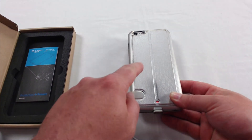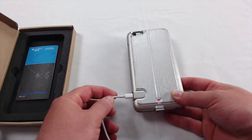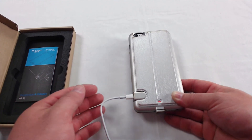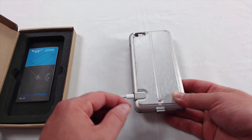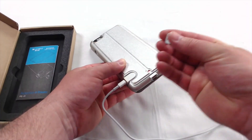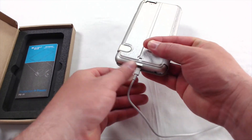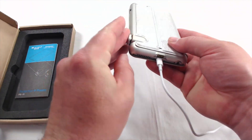The lightning cable charges the battery and charges the iPhone. The only drawback is that data cannot pass through here — only power. So if you want to sync with iTunes and you're not using iCloud and you're actually plugging in with a cable, you have to plug it into the phone directly. All you have to do in that circumstance is unplug the jumper, plug your lightning cable into the iPhone — there's nothing blocking it — and make sure you put the jumper back on the case.